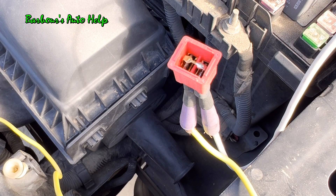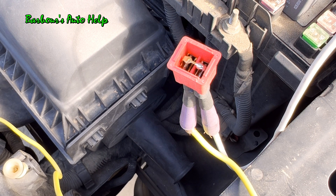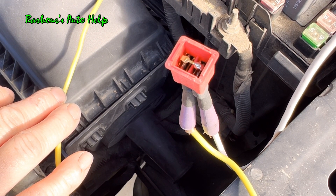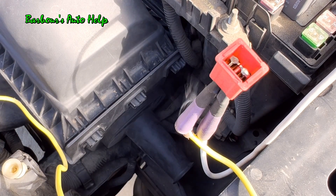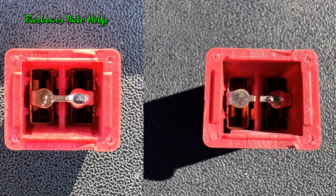Okay, and here's our next fuse in line. Something to keep in mind about this fuse — it's supposed to have some clear plastic on top of it, but this one is actually missing the clear plastic on the top. Let's go ahead and apply ground to this and blow our fuse. Three, two, one. It got a little too hot. Yeah, that was a high amperage fuse. My leads have some resistance in them, so that's why it smoked up like that. And here are the before and after images of this particular fuse.